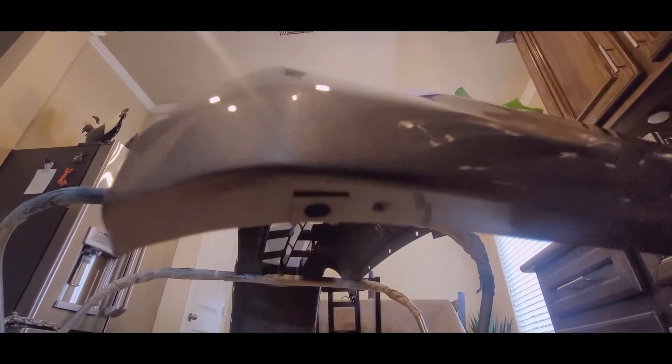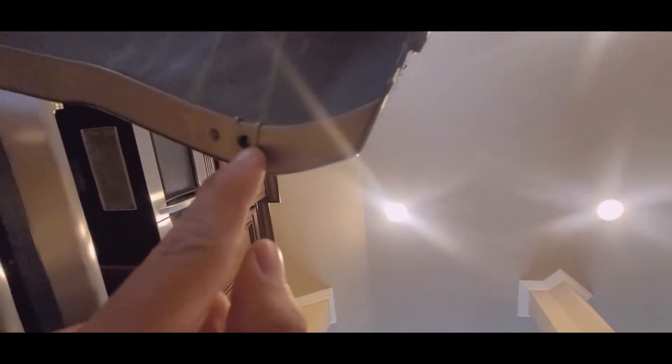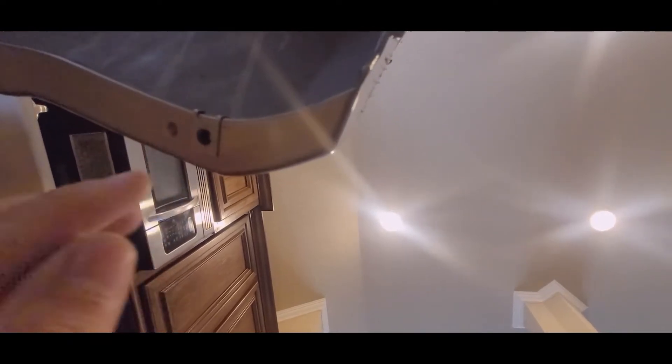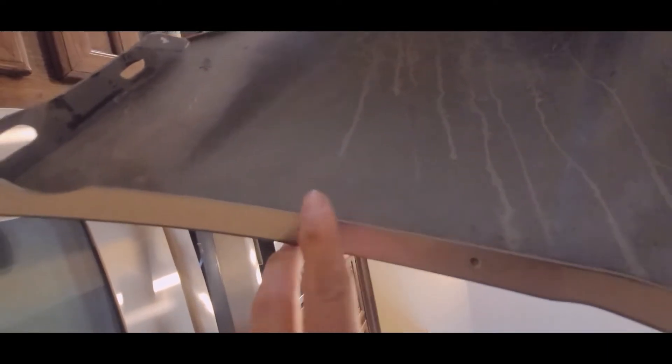To get this to fit perfectly, you want to put your spring clip in while finding the Y-axis because the clip will go all the way in and then you can mark your hole — that will help guide exactly where it needs to sit. If you look at bumpers online where these holes would be, this is actually in the center, but the CR one is a little more towards the inside of the car rather than the outside of the bumper. Same thing here — it's a little skewed inside rather than outside.